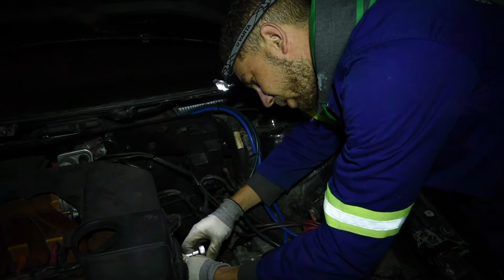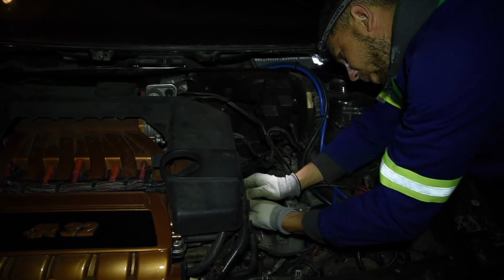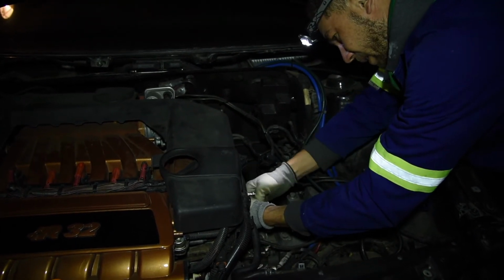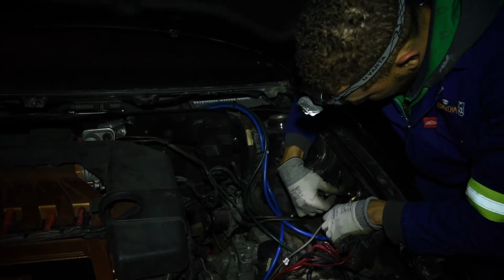Your potential is not based at 0. Now, in actual fact, your foot is off the throttle, but your car's computer box is reading a voltage of 3. So your engine might be revving with your foot off the throttle. And this is what I mean by having proper grounding.